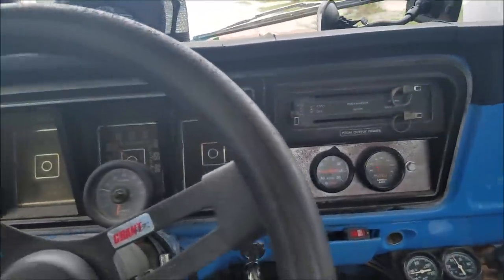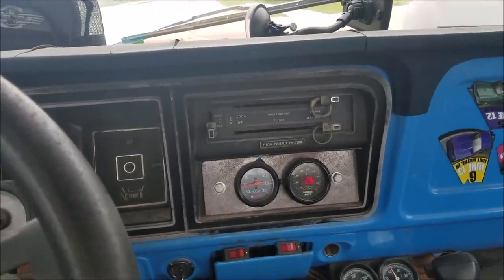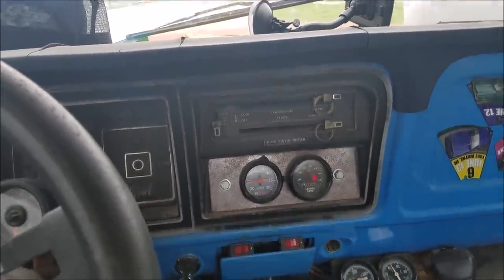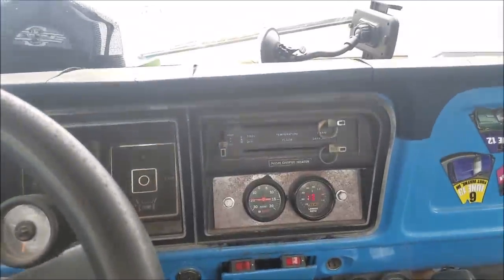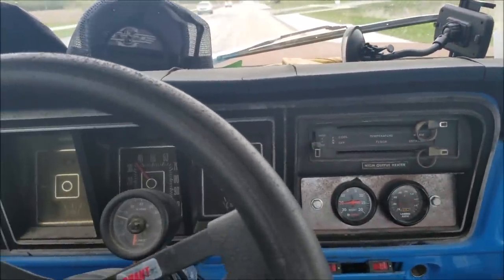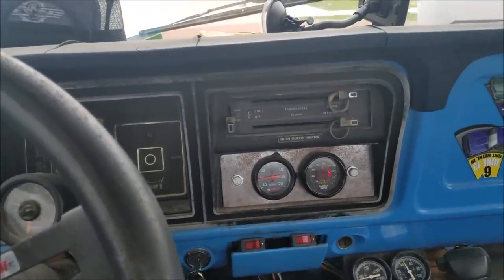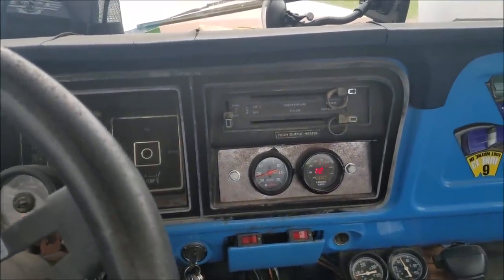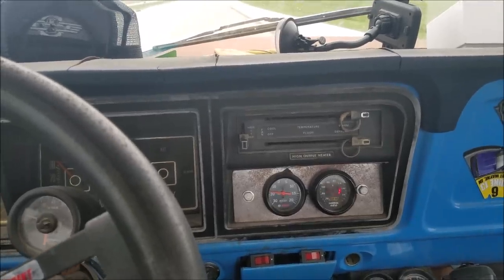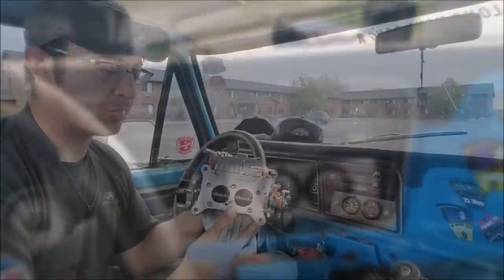Just to demonstrate this relationship, we're going down the road at about 1,500 RPM in fourth gear. It's taking some throttle input to keep us going. Now if I let go of the gas pedal, our throttle blades on the carburetor are going to return to their idle position, and since we have a higher RPM, that manifold vacuum is going to be much higher. And there you see it — it went up. Release again, and there you go.